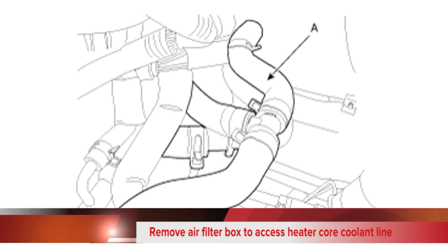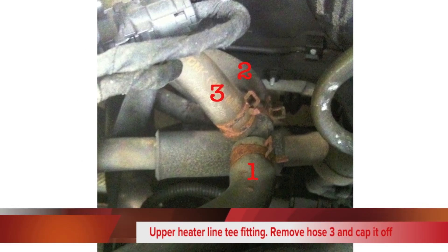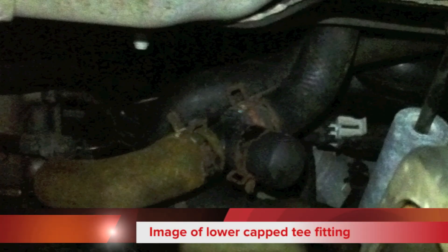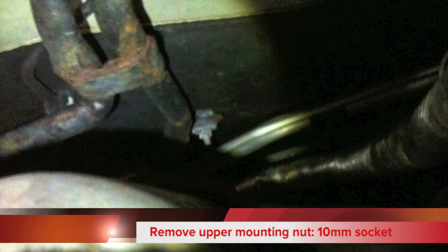There's the capped rear section underneath the air intake. You can remove that and you'll see the T-fitting — you should put a cap on that number 3 there. From the underside, there are actually two of them. That will send the coolant straight from the engine block to the front heater core and back, and it will totally bypass the rear system.